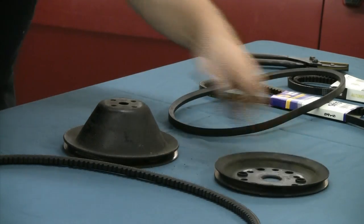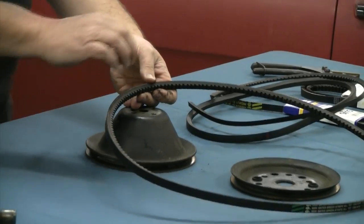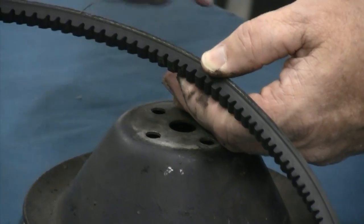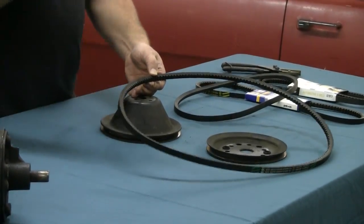If your pulleys are too loose, you can have another problem. This belt from the '69 Fairlane wagon was a half inch off in size — too big. I couldn't open up the power steering enough to make it work, and it was actually grooving the belt as it went around and smoking the belt. If you get up enough RPM, the belt slips on the pulley and actually smokes — you could fill the car with smoke. Always make sure you've got enough adjustment room on your belts.